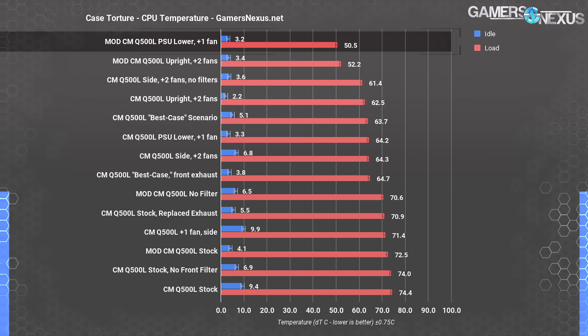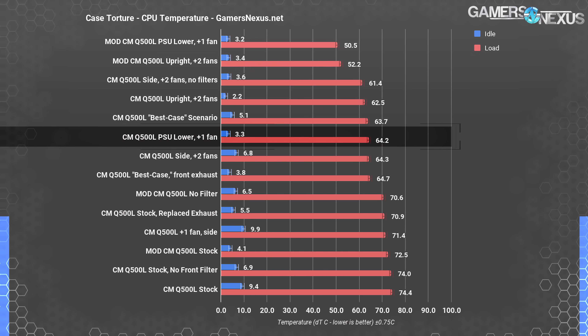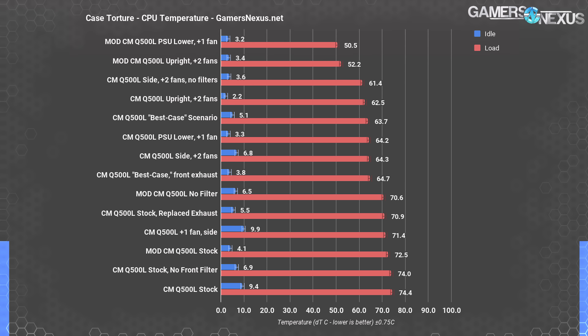This dropped temperature to 50.5 degrees over ambient, another massive reduction — about 13 degrees from the original 64.2-degree result in this configuration. Cooler Master might as well have put a flat steel sheet in front of the fans for this case. We did observe a lack of improvement from adding a fan positioned in the bottom, but that's because it's pointed straight at the GPU, which basically compartmentalizes the top of the case since this video card is about the largest you can possibly fit in here with the power supply used.